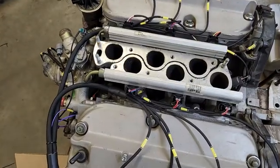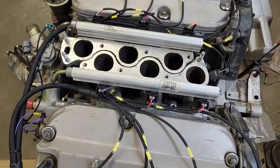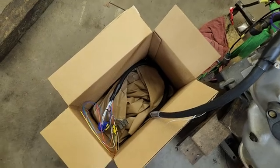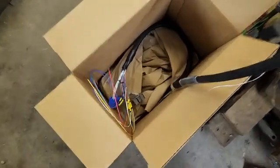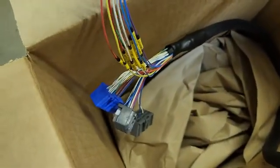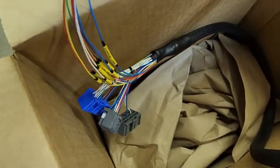What is up J-Series folks? This evening we're going to show you how to best route the universal J-Series style harness onto a J-Series engine. Come over here to the engine where I've got the Joker set up. You'll see right here I've got everything routed. We've got the end of the harness here that hooks up to the ECU. We've only got three plugs on that because there's no sense in hooking up a speed sensor — it could be hooked up to anything from a CD009 to a 700R4 or whatever.